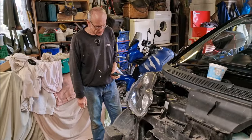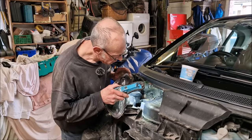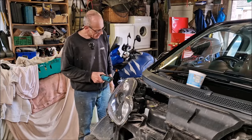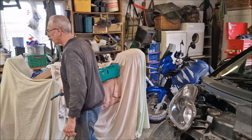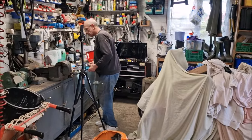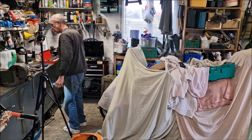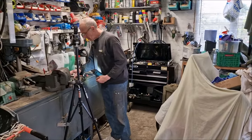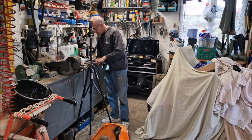So we had a look in the previous video — there was some blue piping. You don't reckon that that is original? No, it must have had some damage to it, because it's got some sort of joiners to them. Do you think that's what's causing us an issue? No. What can we look at to try and diagnose this brake pedal travel? Could it be the brake fluid is low? No. Could it be air in the system? Yeah. Is that a case of just bleeding it? Yeah. Okay, that's one thing to try. What else? I'd half expect that the back brakes are slacking off — been tightened up. Are they not automatic? Yeah, but it might not be working.